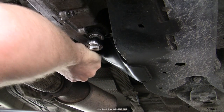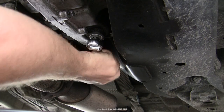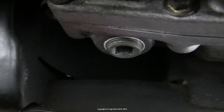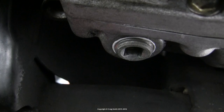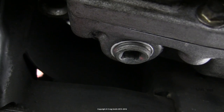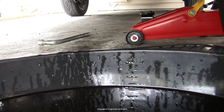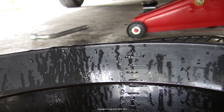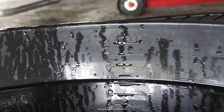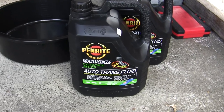Get your ratchet and do it up tight again. The Ford specification for torque here is 27 Nm if you have a torque wrench. You can see how that one little bead of thread sealant has made its way all the way down all the threads of the plug and formed a little circumference of excess — this is a good sign that we used the correct amount. So what we have now is an empty sump, and you need to take note of how much oil you actually got out of it. It was about three litres before, and now it's nearly five litres, because I left this car for almost 24 hours dripping overnight. So we're now going to put back into the sump new oil of the same volume.